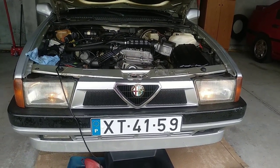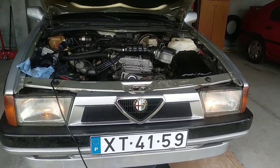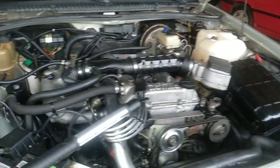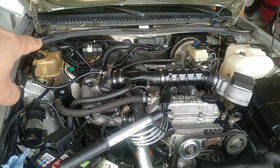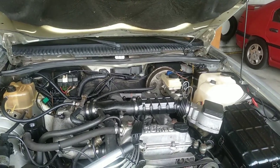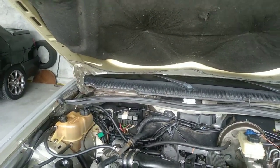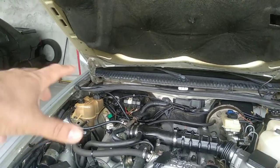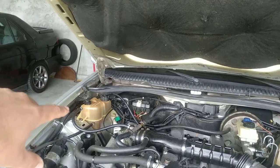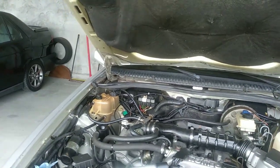So it's still not working — that is a very good sign. We are about a minute since the last engagement of the cooling fan — that is very good. If you want to check for leaks, now is the time. Take your light and try to see if you have any leaks. Don't try yet to level the antifreeze because the first time you do this job, you always have some air trapped — it's inevitable. If you open that cover right now, you may be fooled by some false pressure because air pressurizes more than liquid due to vapors. So wait like an hour, two hours, or the next day. Don't worry about the level right now unless it's really low. Worry about seeing if you have any leaks on any parts of the antifreeze system.